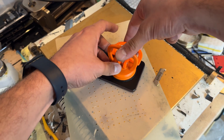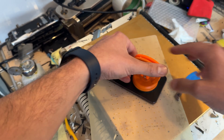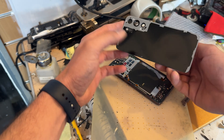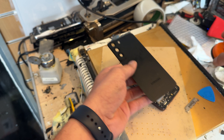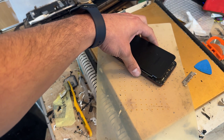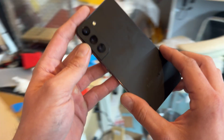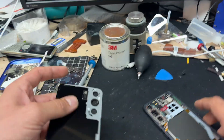Once it's been sat on there for a few minutes, stick a suction cup on the back. We can tell straight away that this one's been off before. On the S22 it's a plastic back cover and so it's very, very difficult to break it. Take your time, use the suction cup to lift it up, a little bit of alcohol to loosen the adhesive around the edges, and then a plastic prying tool to help you along. I'll try and link another video which explains it better in the description below.